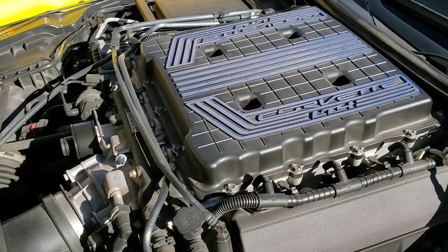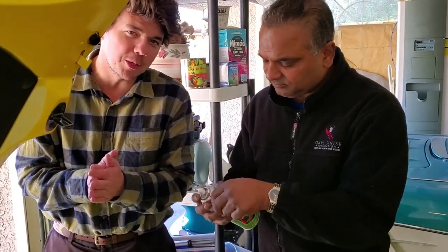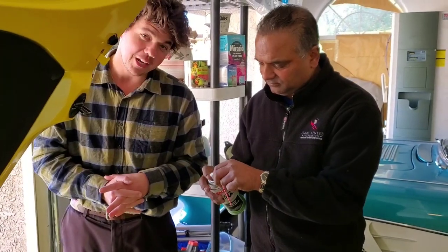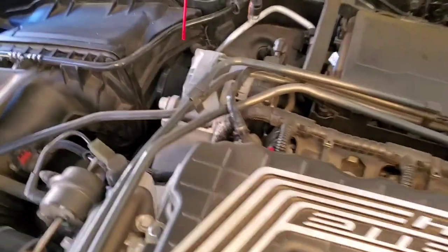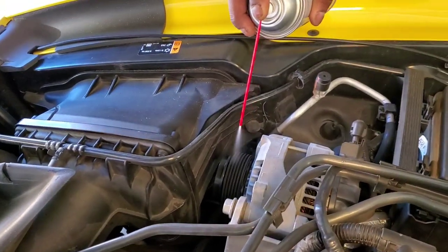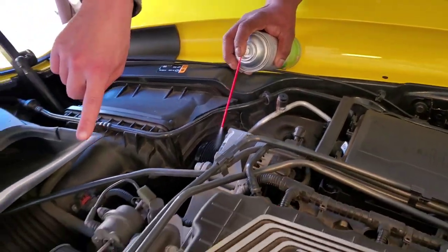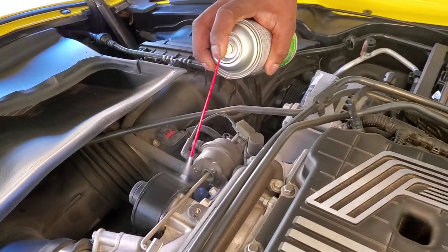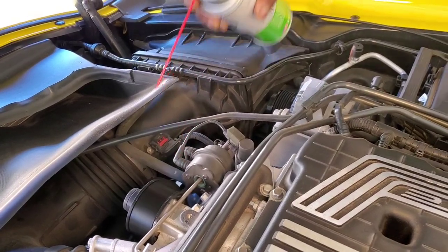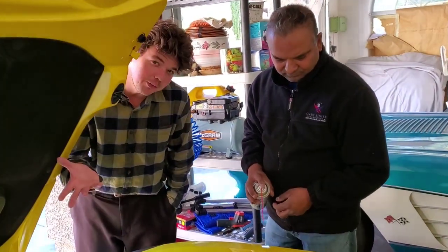Here is the after. While we're idling, we're going to throw on our silicone spray. What this is so good for is rubbers, plastics, anything that's super soft and flexible. This helps with UV protection and it helps keep it moist — you can treat all your rubbers and your serpentine belt. So we're going to hit the serpentine belt. Go ahead and hit that sucker, move down — just keep going back and forth. And you can hit this belt here too. You'll actually notice it'll get quieter. If you have any belt squeal, this will actually help a lot. I do this on my car every year.